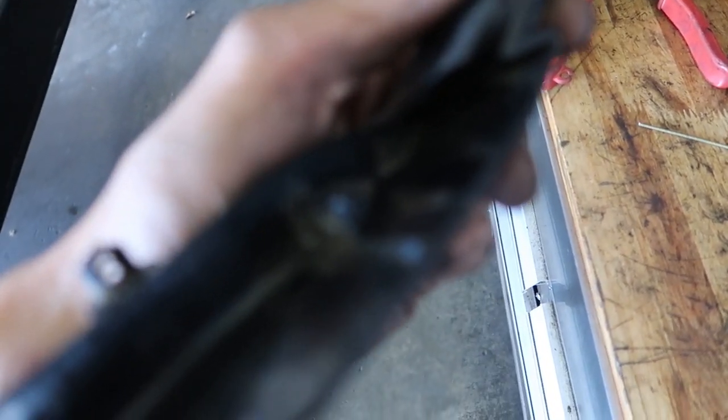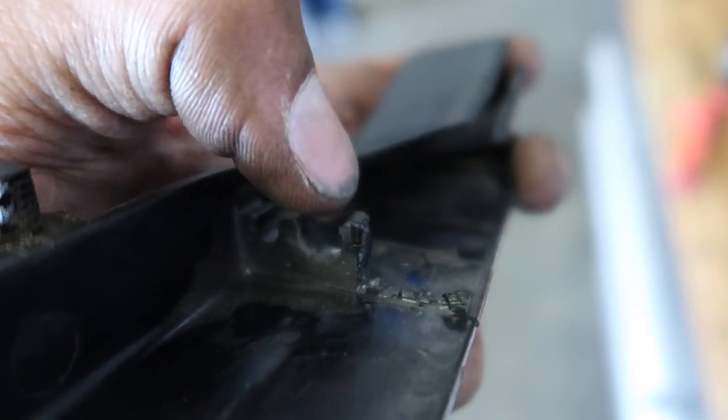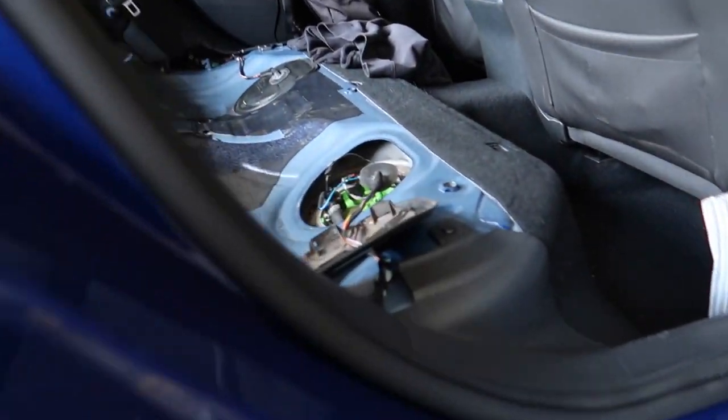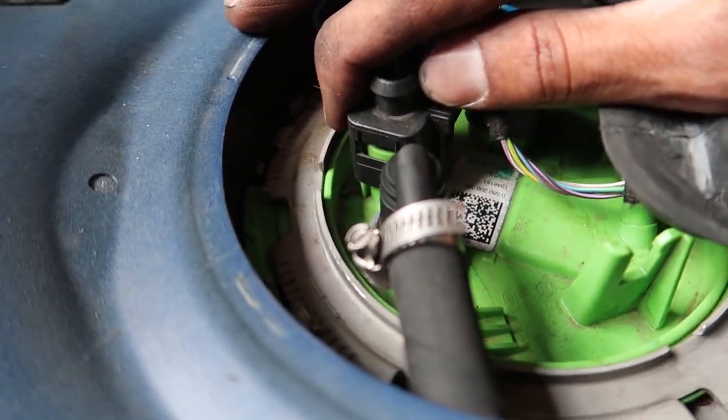There were two spots where the fuel lines were connected. I cut this one off because the new fuel line isn't going to sit in that little hole, but the evap line will, so I had to modify this heat shield. I know you guys hate worm clamps, but there she is — that's the fitting provided with the kit and the clamp, and she's on. I'm going to purge the line into a bottle or container so any dirt and debris that got in doesn't make it near the injectors, since this is already after the fuel filter.